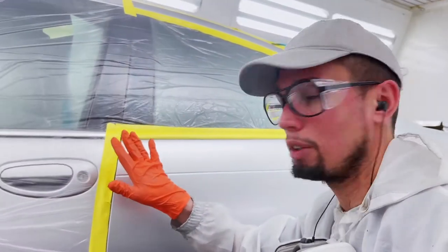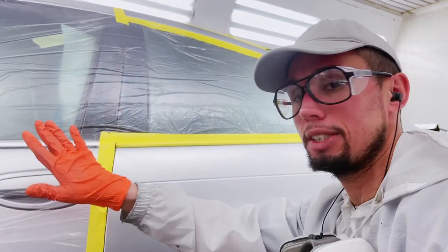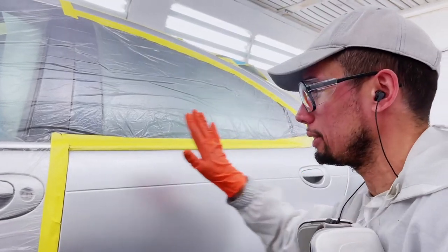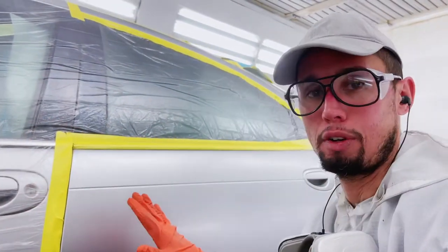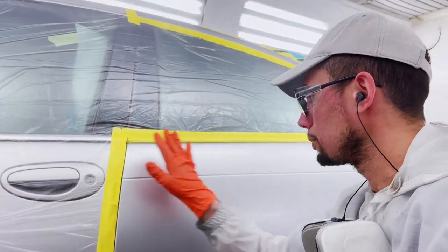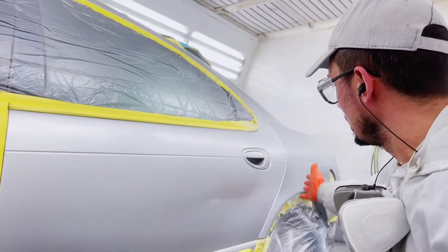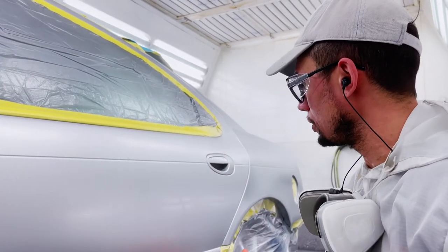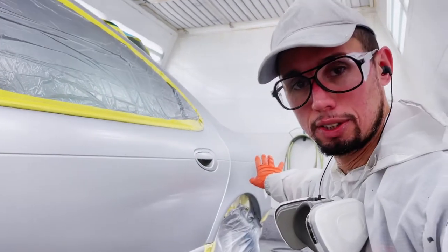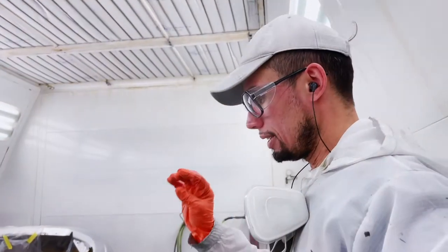You don't want paint in the front of the panel because you want the front of this door to match the back of this door. If I put that paint all the way to here, this door is not going to match the current paint. But since this already matches what's currently on here, I don't touch this area with paint. I just blend it, transition it easily into this door, make it disappear in the transition, clear it, and this all stays the same and looks nicely painted and matches the paint color nicely and seamlessly.